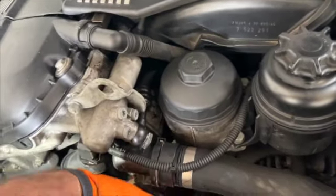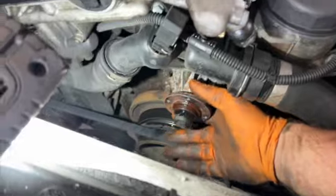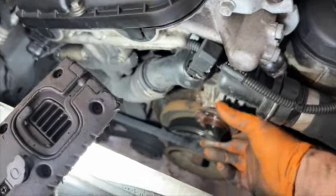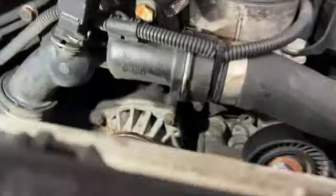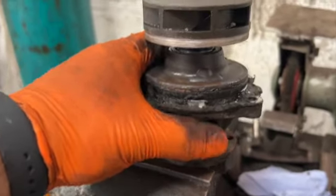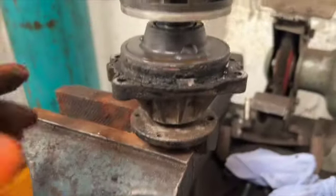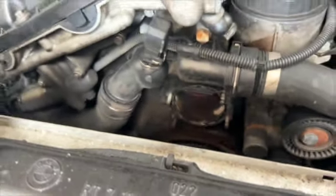The reason I put one bolt in is so when it pings off it doesn't just fall to the floor and get annihilated. You can see there's quite a lot of debris. All I did was put a bolt in and tap it until it came out. Now with that off, you can get a better representation of how bad this is — really bad. Just a few 10mm bolts and it's off. There's the water pump out, and not only is it getting munched away but the bearings have failed internally, so we'll stick a new water pump in.